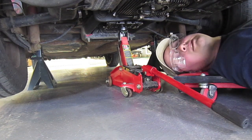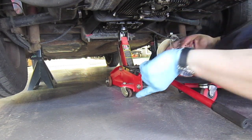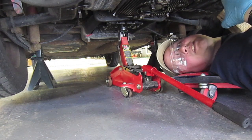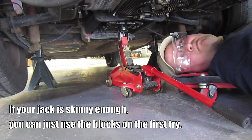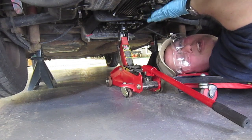So what I'm going to have to do is get it up as far as it'll go, put the jack stands under, let the jack back down, and then use a couple of wooden blocks to give me the extra space I need to put the jack stands where I actually want them. It's kind of tedious having to jack your car up twice for the same job, but it beats being squeezed by an overly affectionate oil pan — you know what I mean?